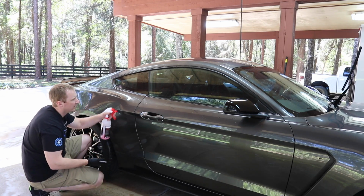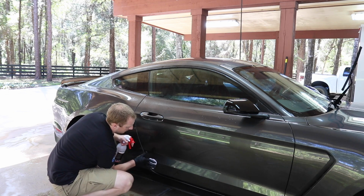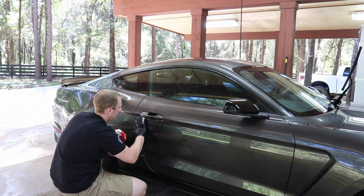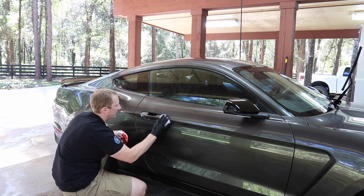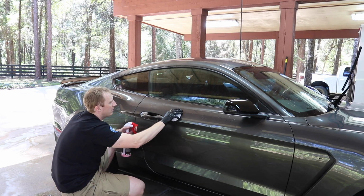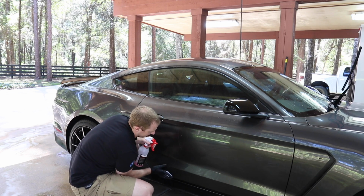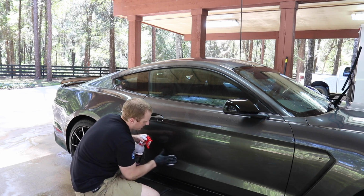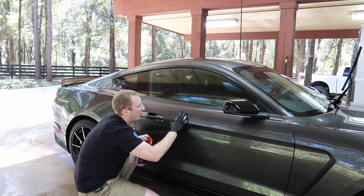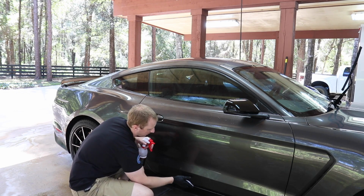But then, of course, you have tram lining and some issues on the road when you're trying to drive down the street. The R has bigger or stiffer front springs, most likely to compensate for the bigger tires, slightly wider wheels. And of course, the big thing, which I would have really loved to have, would have been the carbon fiber wheels. Those are freaking cool. Not the best looking wheels in the world, but who cares? They're like 12 pounds or whatever the heck they are. So I would have loved to have that.